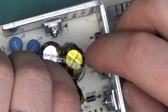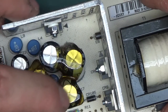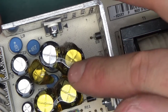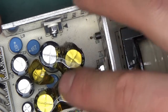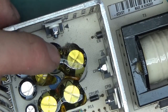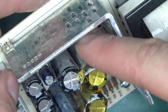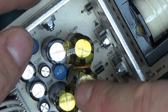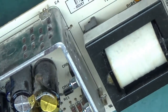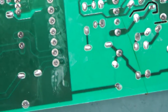The resin has become really crumbled over time, but strangely they've poured it over the venting holes. So if a capacitor went bang, the cups wouldn't be able to vent properly — this was quite sticky when new but has become brittle. Normally you'd put some elastic at the board where the cups are to stop them wobbling, but that's what they've done here.